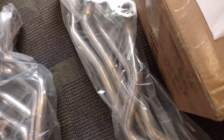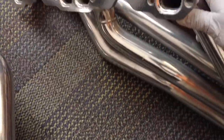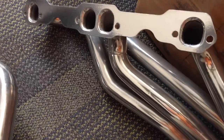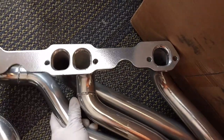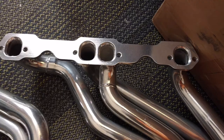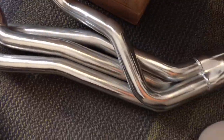Let me put this other header around. Packaging is decent — you don't need bubble wrap or anything like that. I don't see any damage. Let me get them out of the plastic. First impressions, I am impressed with these. These are one and seven-eighths headers coming out. You can tell they neck down just a little bit to meet the ports. I am really impressed with the flange — this is a nice thick flange. I like how the header tube is welded inside the flange. I bought a set of Vortec headers for my pickup and the tube was welded outside of the flange — it was the worst header I've ever owned. It would not seal at all. I had them on for maybe two days and took them off and went back to the exhaust manifold. They were horrible, and those were Pacesetters as well.